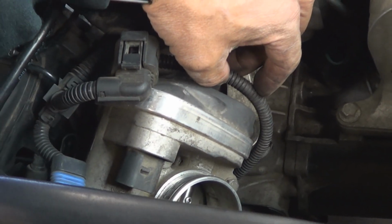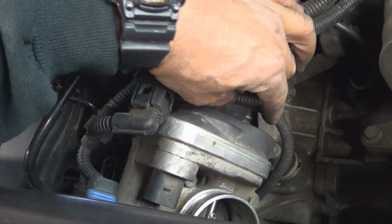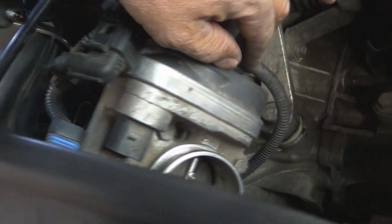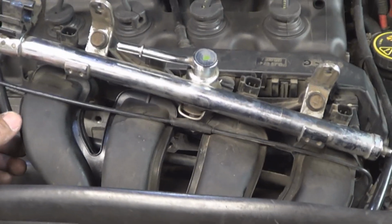Moving this connection around the throttle body is a little bit hard. You have to tilt the intake manifold slightly. And trying to disconnect it, good luck, it's pretty tight in there. So if you move the intake manifold to the side, you can make it clear. You can see I got the intake manifold sideways right now, so now it's time to remove it.